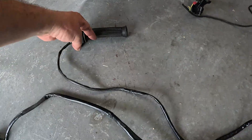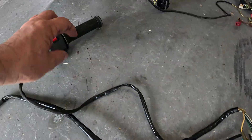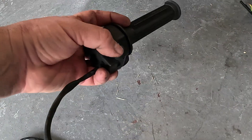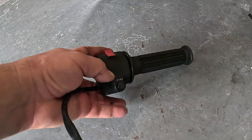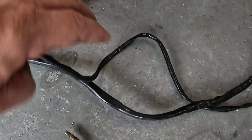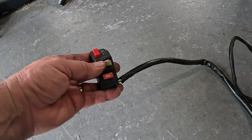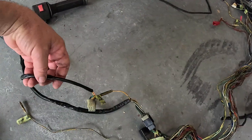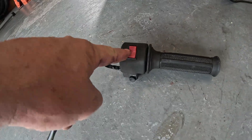Going further up we come to the handlebars. The right handlebar has the throttle, a start switch, and a kill switch. Those are nice switches — you may want to keep them. You can pull it apart, get rid of the throttle, and just keep the switch housing. You might use one as a reverse or something else. Personally I'm going to take this whole side off and not use it. I am going to use the left side: low beam, high beam, left and right blinker, and horn — all things I need, so this stays with the harness.